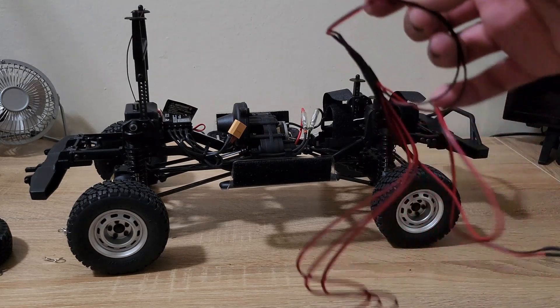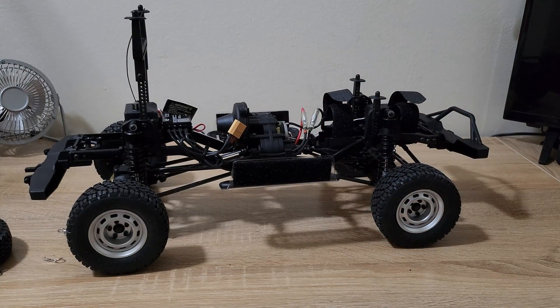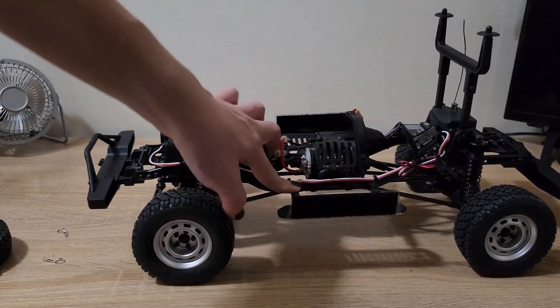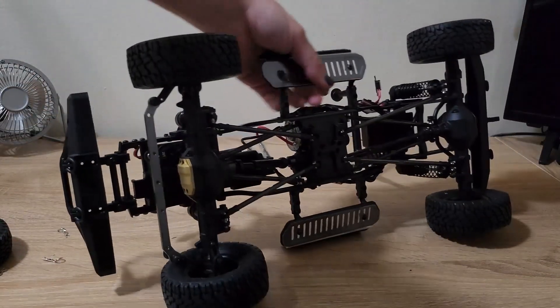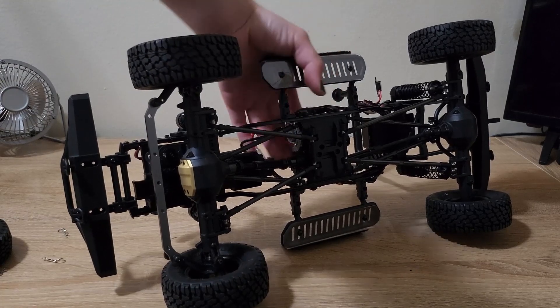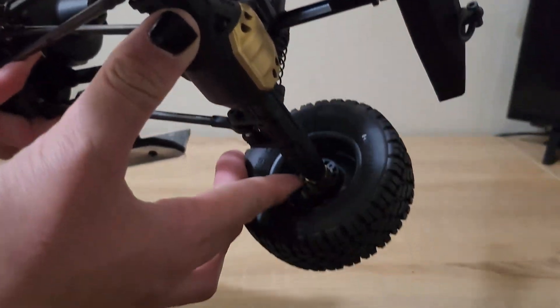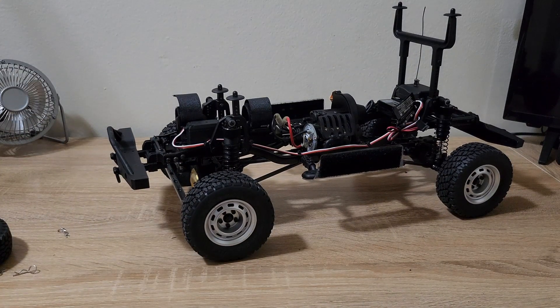It also includes an LED set — comes with two whites, two ambers, and two reds. The headlights don't have provisions for the ambers so they're kind of useless to me, but it's cool that they're included. The motor on the 2.1 edition is a new five-pole motor, so very smooth — that should be a very good motor. The servo is a metal gear servo, and with the limited edition you get a metal servo horn as well as metal steering links. You also get brass diff covers front and rear, as well as brass wheel hexes — a lot of cool little upgrades.